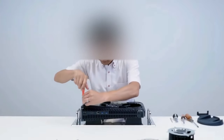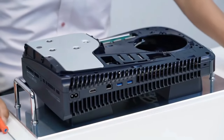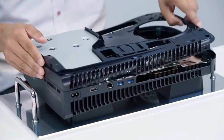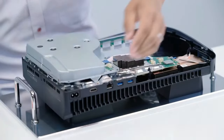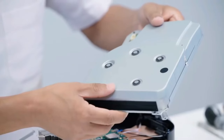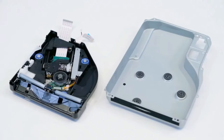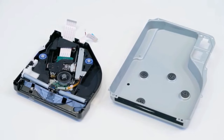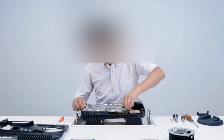Specifically the PS4 Slim — I'm not sure what's in the original PS4. You take off those screws and then we should be ready to take off this part of the cover. You can already see the Blu-ray drive right there — that's the Ultra HD Blu-ray drive unit. Once you take off those two screws the cover comes off easy, but there is a screw holding the black part to the silver part, so if you want to go further you'll need to address that.